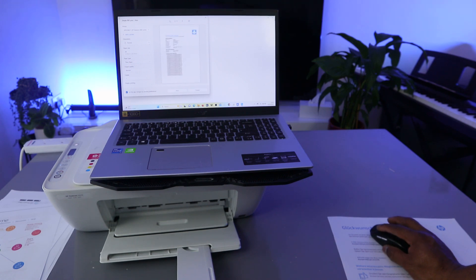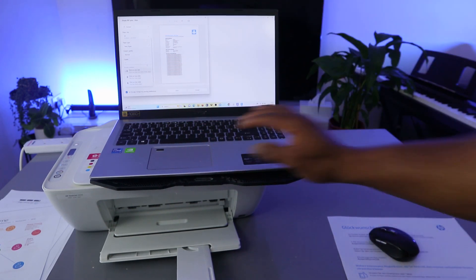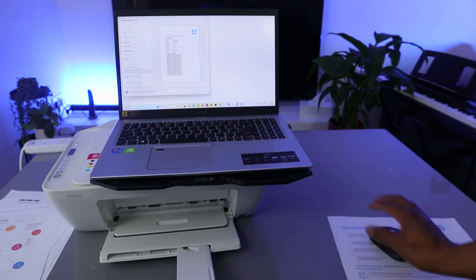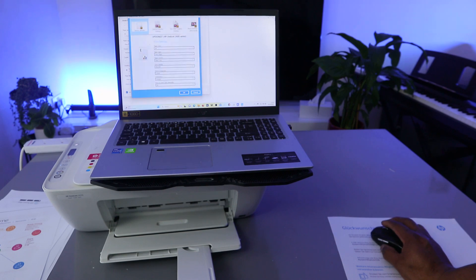You can see it's one of two pages. You can select to print it out. Previously we printed it double-sided, so this time I'm going to print it black and white on one side each. Select More Settings — that gives you the option to select color. I'm going to change the color to monochrome, portrait, print on both sides: no, and print all pages. Select OK.